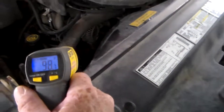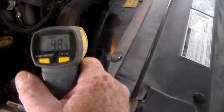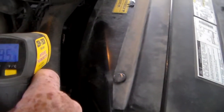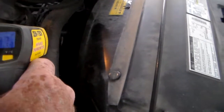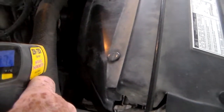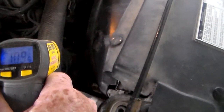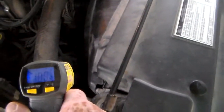I was talking to a friend of mine this week and he said try this little laser thermometer — find the pulley that's hot. The fan blade is reading 99. Let's go over to the power steering pump. What it's showing me is: power steering, the fan blade pulley, harmonic balancer — they're all running about 99. Air conditioning pulley running about 99 to 100 degrees.